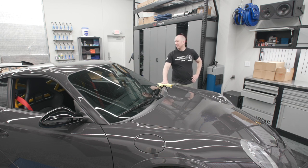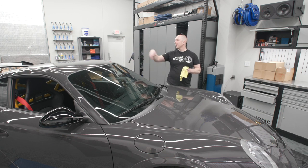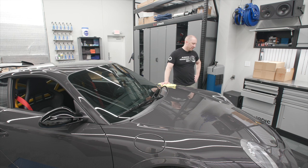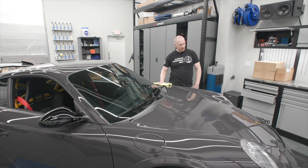I'm going to stop here and save the roof and the rest of the car for after dry ice cleaning. Then I'll wash it, decon it again with some decon soap or reset, and polish the whole car with that same procedure — Rupes DA Fine on a yellow pad. I'll do the stripe on the hood and the Porsche emblem on the back. That's how you would repair PPF. I may do another better quality video on this when WAV is here, and we can work on it together — we'll call it correcting or perfecting paint protection film. I've polished it before, but not to the scale of the whole car, so it'll be interesting to see how it goes.